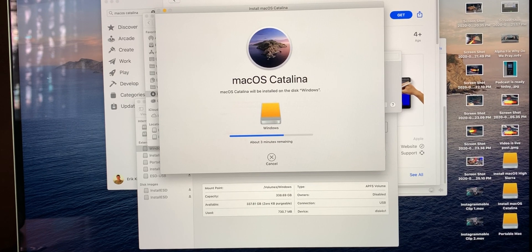So I got into some digging. I talked to one of my friends who's a technician at the Apple Store, and he said there were two things that could be the problem. He said the T2 chip probably only likes Mac OS because that's a certified program through Apple, and since the drive was straight Windows 10, it probably wouldn't work. So he recommended that I completely wipe this drive — which I did — and install Mac OS Catalina on it first, then boot from the external drive and do Boot Camp utility to put Windows 10 back on it.